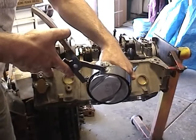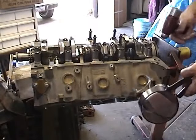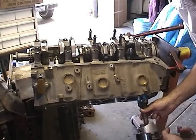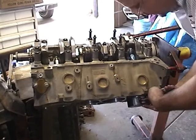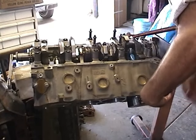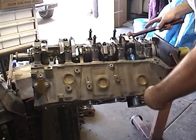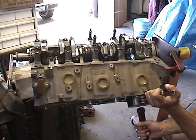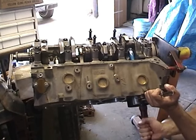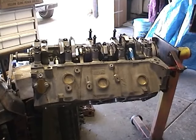Put our tool on here. We're going to go ahead and guide this in like so — get the piston started in there. Eyeball the end of the bearing end of your rod and make sure it looks like it's going to be straight going on that crankshaft. Hold your piston ring tool firmly and just tap it in. It goes in smoothly just like so — no problem at all.